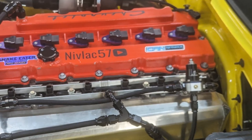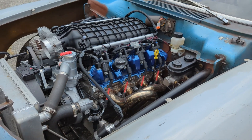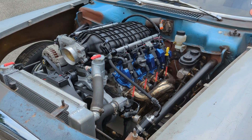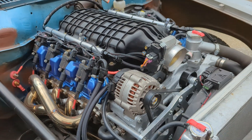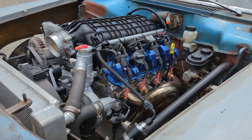This is not the first time that we have run a brushless fan on one of our cars. We're actually running a Delta PAG fan on the 2010 Camaro build, and we also ran one on my 63 Studebaker. What we have found is that it is way more important to have good airflow than it is to have a big core on your radiator. In fact, I reduced the size of the radiator core on my Studebaker, and because I put such a beefy fan on it, it actually cooled better than it did with the old setup.